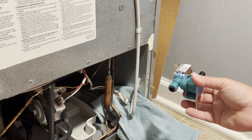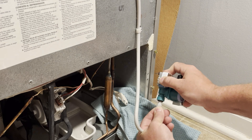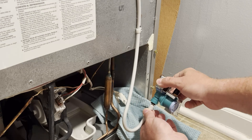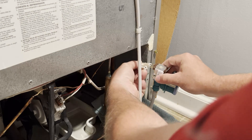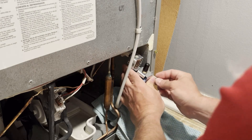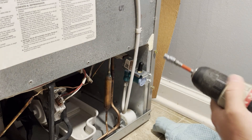Let's go ahead and install the new valve the same way we removed the old one. Get the water line and press it in evenly and firmly until you can't press anymore, then kind of pull it down and do a quick test — pull on it gently and it should not come back out. Now is the easiest time to connect the wire back on, so press that back into place. Then reinstall the mounting bolts — get them started by hand first, then use your drill or ratchet to tighten them up.